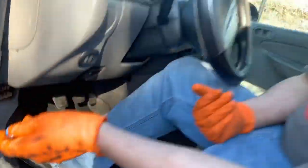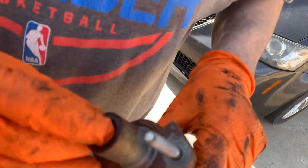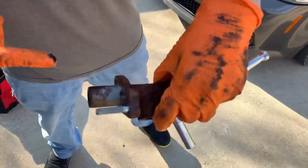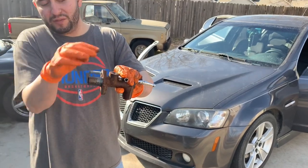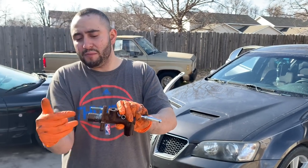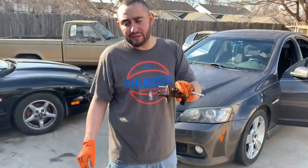That was our problem. The culprit was that master clutch cylinder. So the failure most likely was in here. That's what you press down. The clutch pedal has a rod, and it depresses and applies pressure in here and pumps it. Then out of here, you have inlet brake fluid down here, and this is the outlet which runs down to that slave cylinder. Pump it here, creates pressure. So we were pumping it, I cracked that bleeder valve open and let the air out. I'm gonna bleed it a couple more times, make sure we have a real nice stiff clutch, but that's what we're doing.